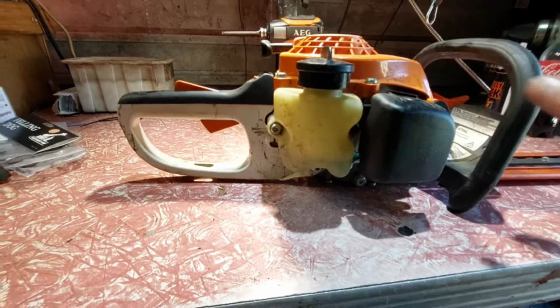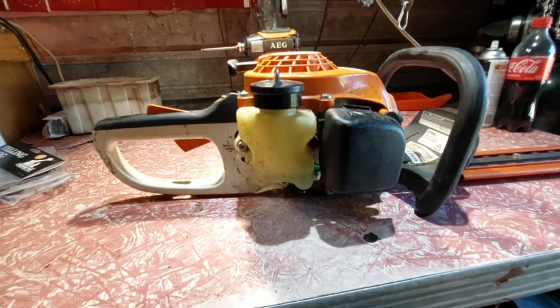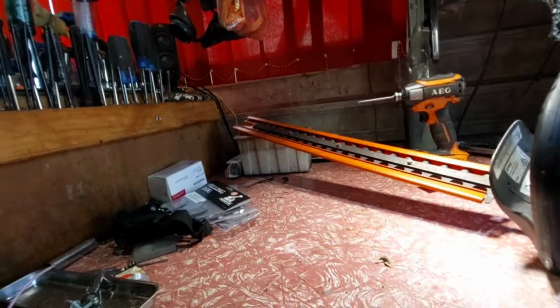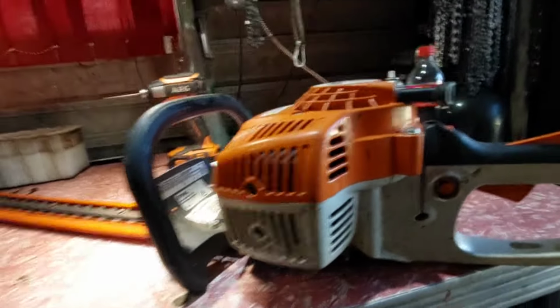So, apart from that, one of the first things you do if you have a small saw or generator or anything that sits around for a while, check the exhaust. Where's this one? This one. I saw it, because wasps make mud nests inside your exhaust. Why would anything want to fly up an exhaust? It must smell nice.